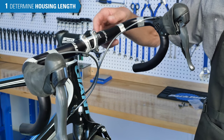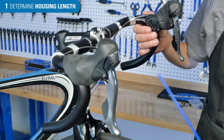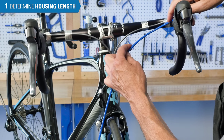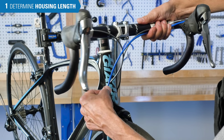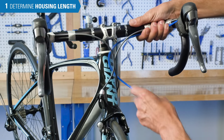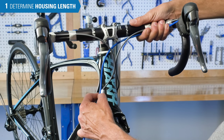This is a traditional drop bar setup with no handlebar tape. We're holding our shift housing with tape so we can see a clear view of our brake housing. We're going to run the front caliper to the left side. Begin by inserting the housing fully inside the lever — the housing passes underneath the shift housing. Think about routing now: if I choose one path, the shift housing pushes forward on the brake housing. Coming behind is more natural and more relaxed, so think about routing as you determine your housing length.